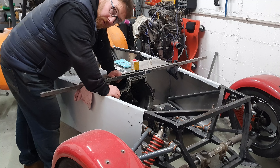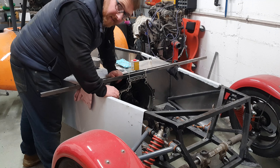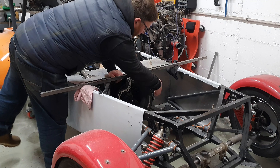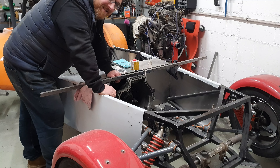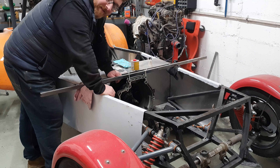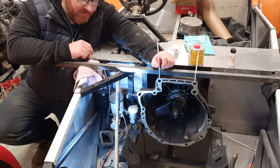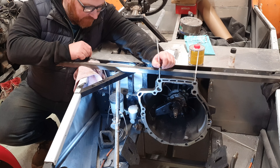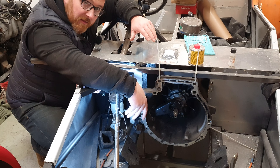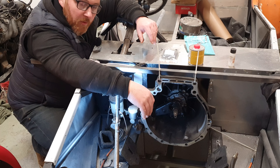That's got to be one of the more ingenious ways of hanging a gearbox without an engine. What do you think? Granted, it won't work in most cars. Anyway, we have put it in, and I have come up with the following. The fuel pipe route from the back to the front is going to be tricky if I did my original plan, which was to run up the top of the console all the way up to here and then just pop out straight where the inlet manifold is. It's just far too congested with the shifter for the gearbox, and I've got to remember that this thing will move from left to right under load and deceleration. However, there's absolutely loads of room at the bottom. There isn't a good reason for me not to put it down there, as long as it's not below the bottom of the car. So I think if we come out the bottom, down to here, and then just snake up and around, that's going to be nice, secure, and just as effective a route. So that solves that problem.